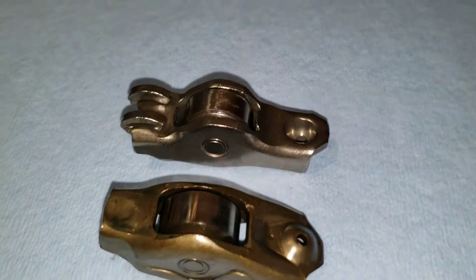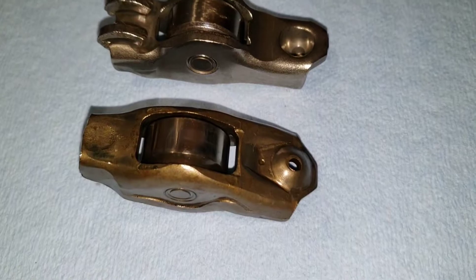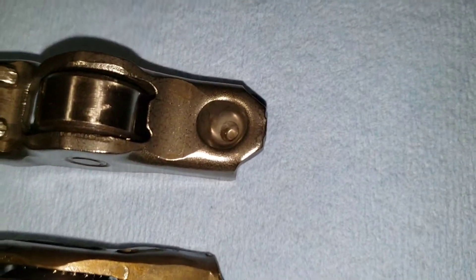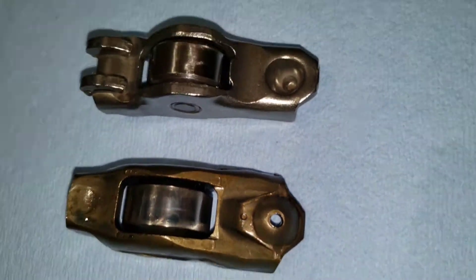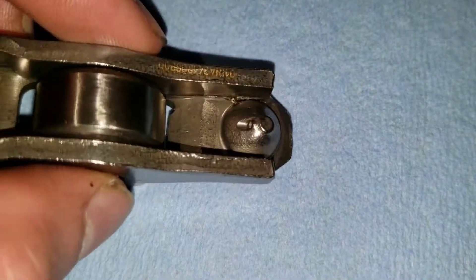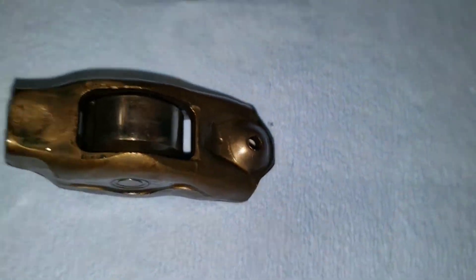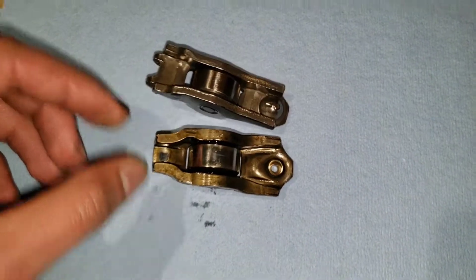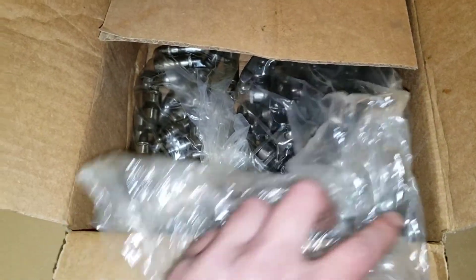There's a difference between the Ford GT and the regular Cobra rollers. I did notice the Ford GTs have a smaller oil passage. So I'm just going to save these for the next engine and reuse my old ones. I got these from MMR if you're trying to get a set.